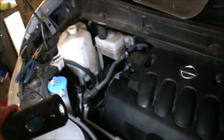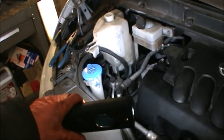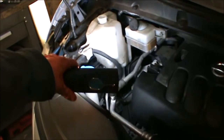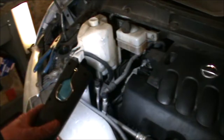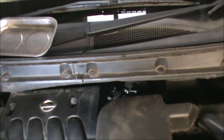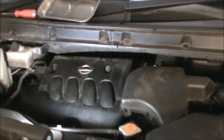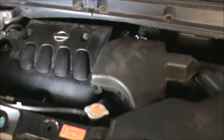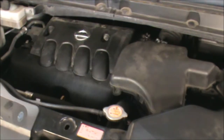We're then gonna have to top up the coolant, because a little bit of coolant would have leaked when we disconnected the throttle body. It's very minimum. I can see this has got green coolant, so I'm gonna top up a little bit. It's about 200 mils, and also the dipstick. Don't forget to refit the dipstick. And well, now I'm gonna get some antifreeze, top that up, and then start the car, and hopefully everything will be okay.